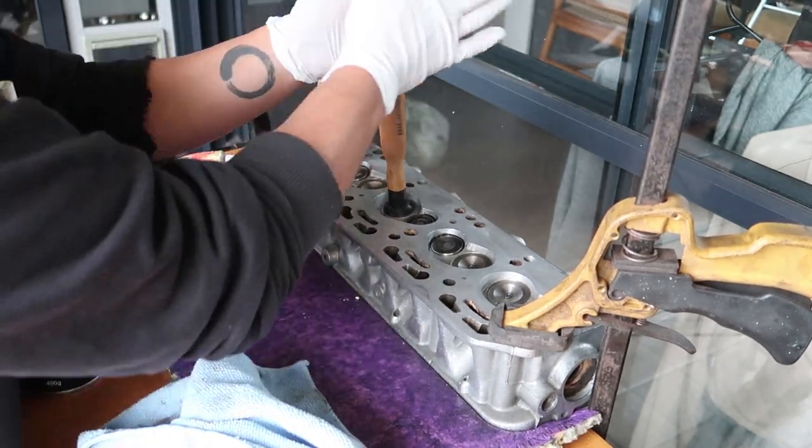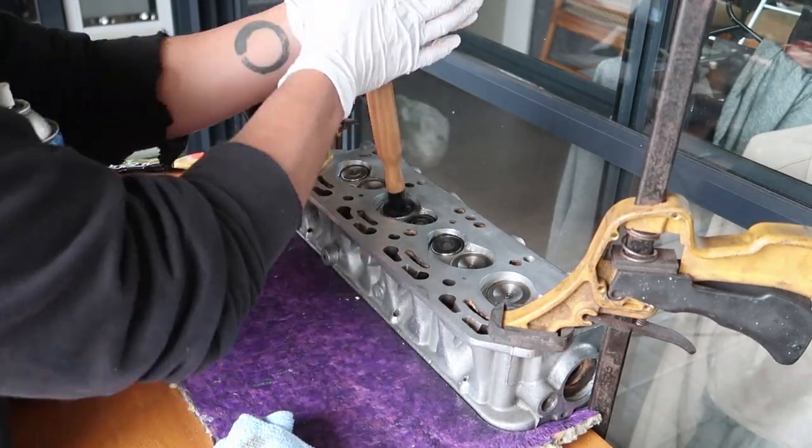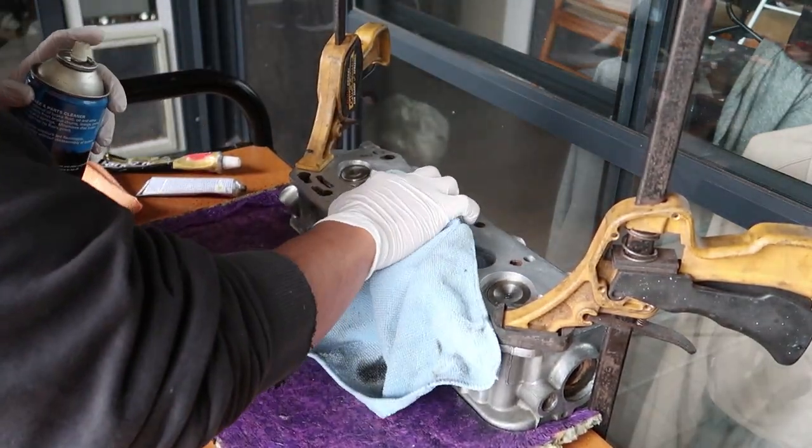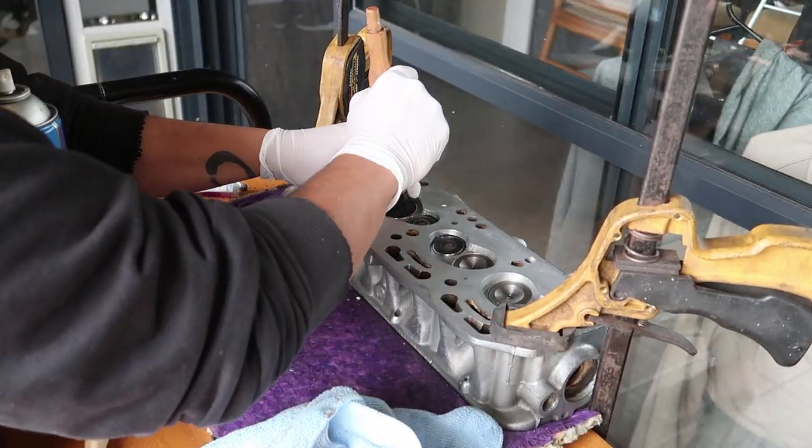These suction sticks are pretty annoying, but I eventually got the hang of it. The goal was to get a visibly solid band close to the lip of the valve. They're pretty easy to see as the valves come with a polished finish from the factory.